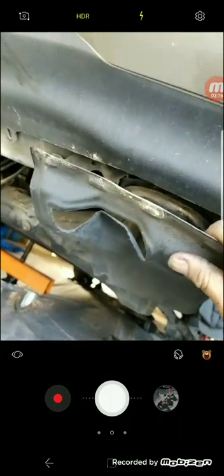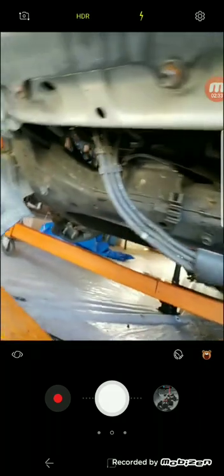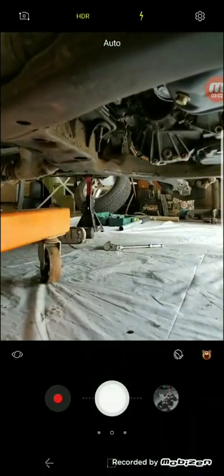I detached a cover right here. Also this cover here — detached from the frame, detached the spark plug wires. There's a motor mount here and another mount right here. We're going to loosen up this bolt here and this bolt. So basically everything that's attached to this frame we're going to take off. This was attached to it — took that off. Same thing over here, took these three bolts off. There's a motor mount there with some bolts underneath that I took off.